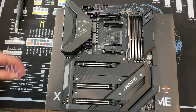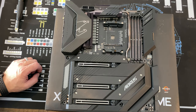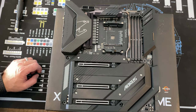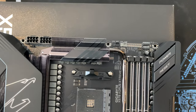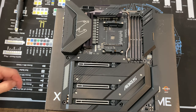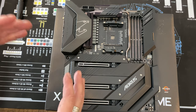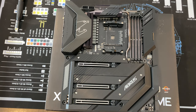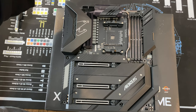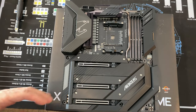I've got the motherboard out of its box — peeled off the plastic, which was miserable for whatever reason. A brief overview of the connections on this motherboard: first off, it does have two eight-pin ATX 12-volt connectors, which should deliver some nice clean power, especially considering this has a 16-phase VRM delivery. That's going to be awesome when using a processor like the 3900X or 3950X. Up top you have your CPU optional and CPU fan headers along with RGB and digital RGB connectors, plus solid power and reset buttons. I like that — very clean look overall.